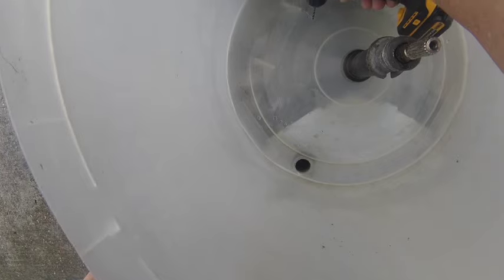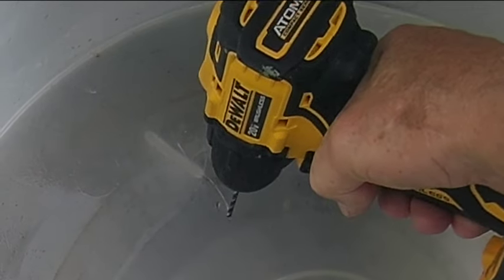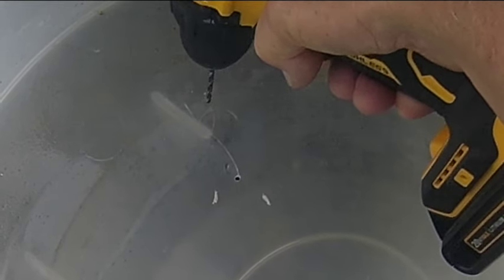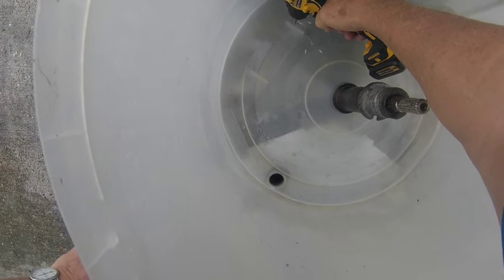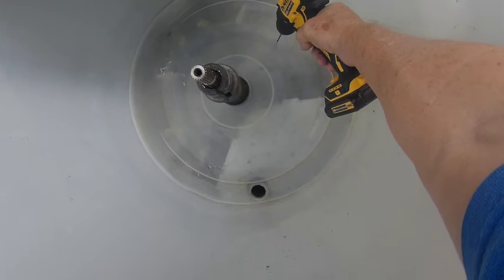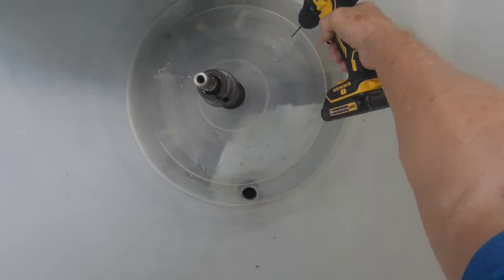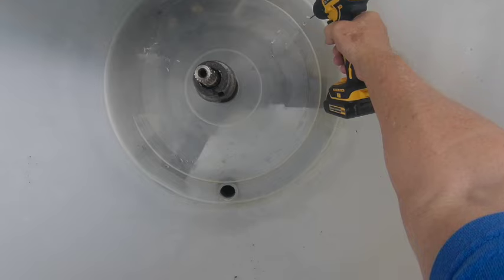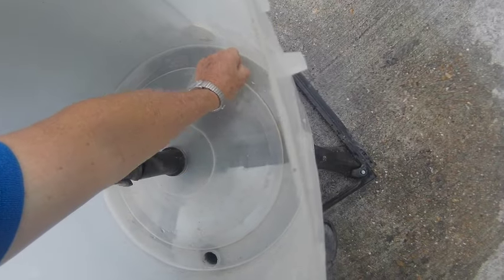Anyway, right at the end of the cracks, you want to drill a stop hole that mitigates the cracks from expanding. This one is a little different. Probably the worst one I've ever patched right here. And let's hope we do it right. See, that one's back in that direction, and this direction. So, let's check it out.